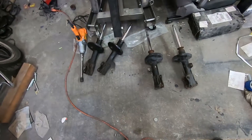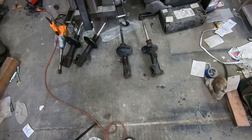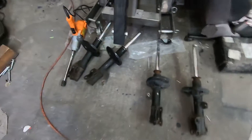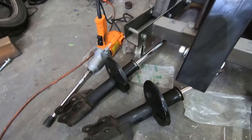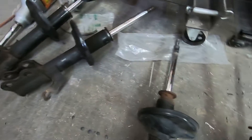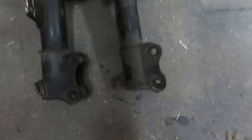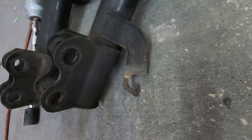And here we are. This is just going to be part one — I'm going to mostly try to focus on just knocking out the coilovers, or as much as I can. It's hot and I work during the day, so here's where we're at. A couple things I didn't notice until after I took things apart: the rear struts — and the fronts — that's where the brake line runs through. If you look close enough, you can see a little slit. They were not removed properly; they were kind of cut out. Like they didn't want to disconnect the lines.